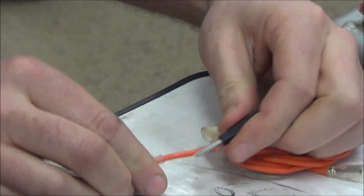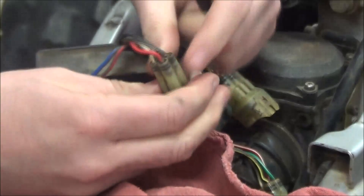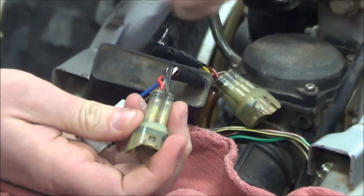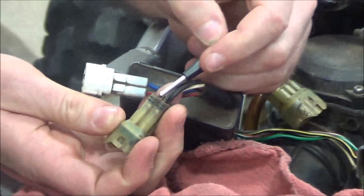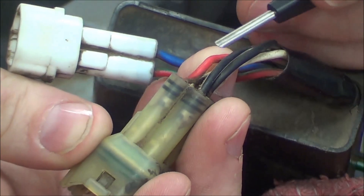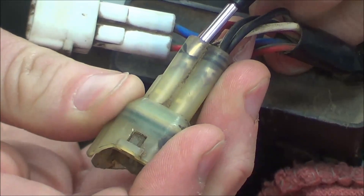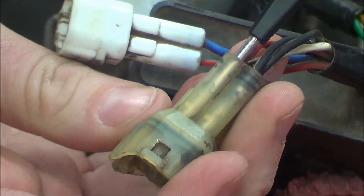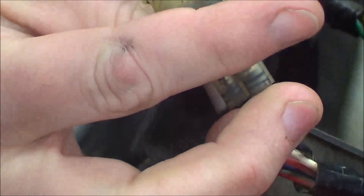So where these are really handy — let's move to the actual motorcycle itself. Let's say that I want to back probe into this CDI box or this harness or whatnot. This is actually going to be great, guys, because of this clear connector. So I'm going to go on top of the wire, right? And do you see how I'm intentionally trying to go around that seal? Because this is a waterproof seal. That's got to be a really nice back probe.